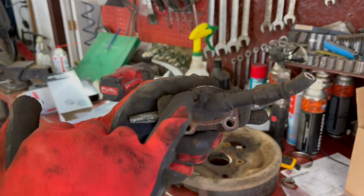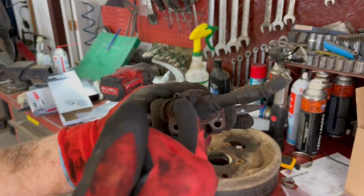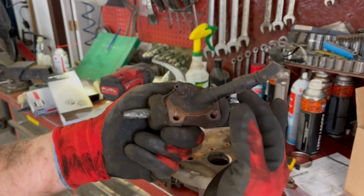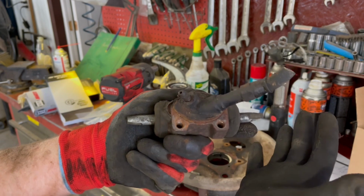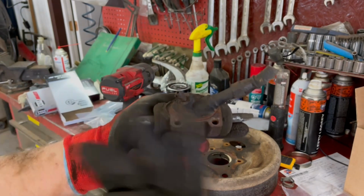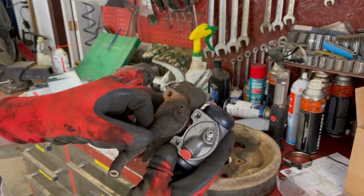And there is a left and a right to these wheel cylinders simply because the way that the brake line comes out one way and the bleeder comes off the other when it comes up through the spindle. So these have an elongated neck on them, and you're going to wrap your wrench right around that when you go take this hose off, if you had to. We're putting new ones on the new system anyway. So you got to make sure you got the right one. We've already put the other one on, so I've only got one left. It's got to be this one. So we will compare the two. They look good, so let's get it in there.